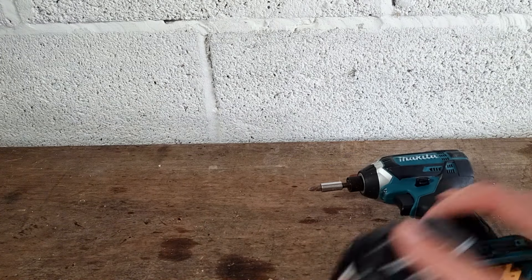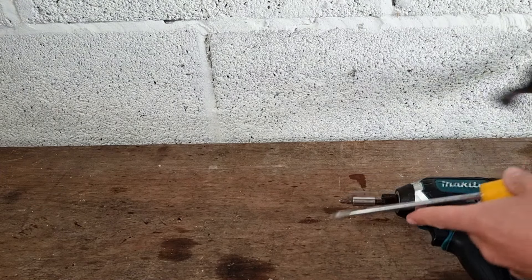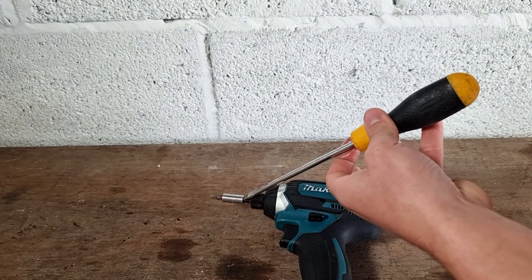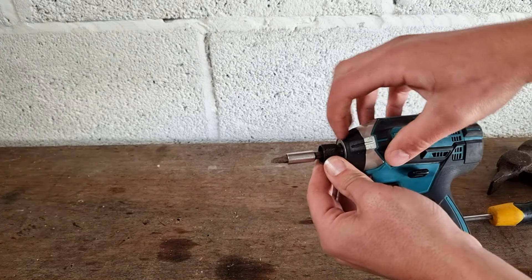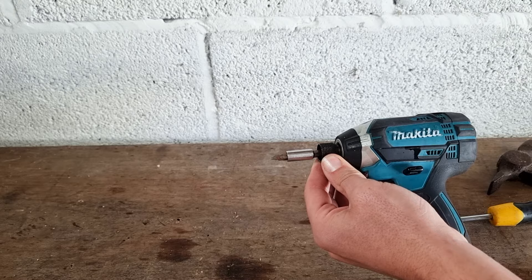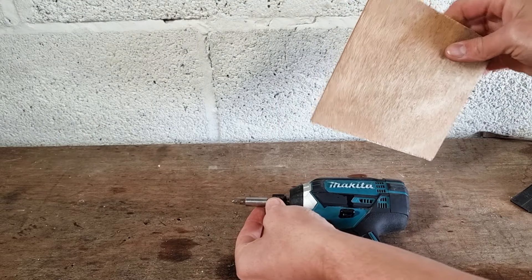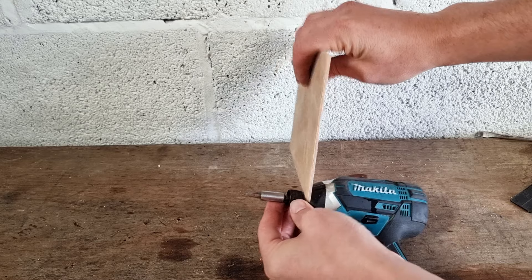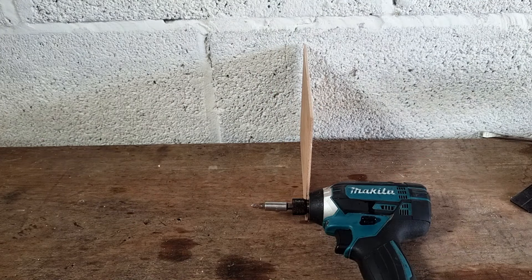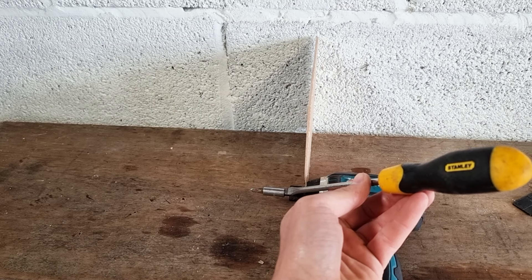So you can hold your drill on the desk and remove the battery if you want to be safer. You need to find a way of pulling this collar forwards, and at the same time just get your flat screwdriver in behind your driver bit and give it a little tap. If you hold your collar forwards, you can put something in behind there to hold the collar forwards — we're going to find ourselves a packer. We've got a little piece of eighth-inch plywood here. Now we've got that collar loose, we're going to wedge our plywood behind this collar so it stays forward. Then take your hammer and chisel, position that behind your driver bit, and just give it a firm tap to free it from the end of your impact driver.